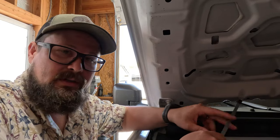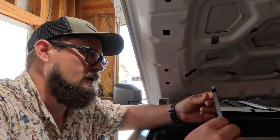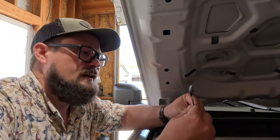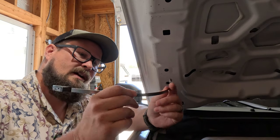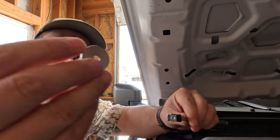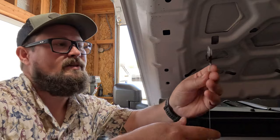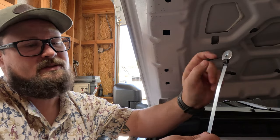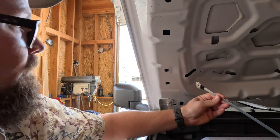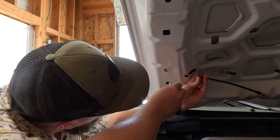This install is super simple. I don't know why it doesn't come from Ford like this. I'm sure it's probably like a $900 option if you wanted to do something like this. But they send you this little flexible thing here and it's got a nut plate on one side. We're going to take this — it's got a washer and the washer is just going to kind of hold itself in there. This is just black tape, all taped together. And this is going to come through this slot right here and through this slot up here to this hole.